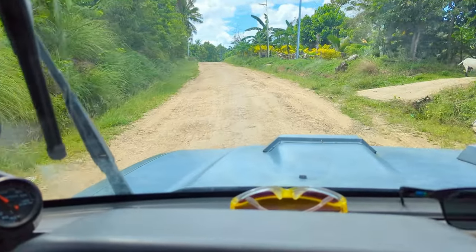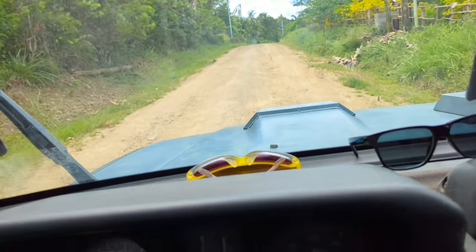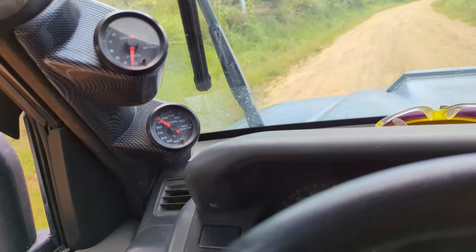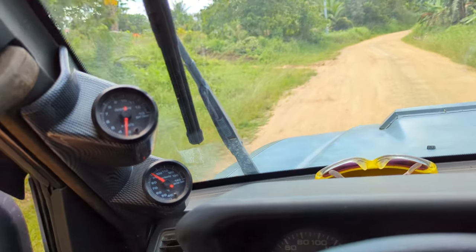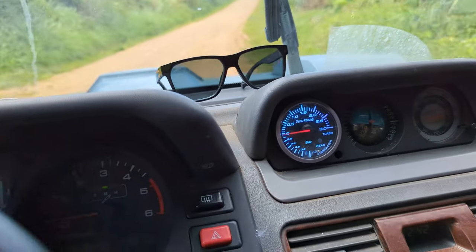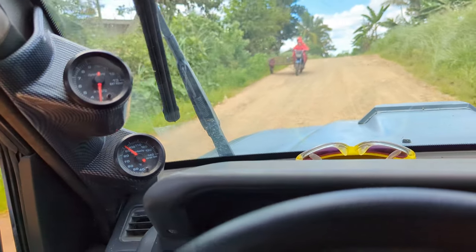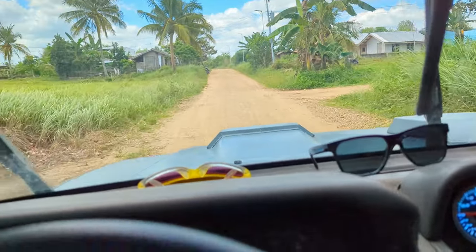This is a serious hill climb — the absolute best radiator test we could have asked for. We're at 90 degrees now. We got up to 92 when I was at 500 degrees Celsius on the exhaust gas and 1.2 bar on the boost. But it hasn't passed 95, and this is a hardcore hill climb on the boost.